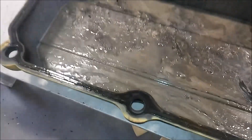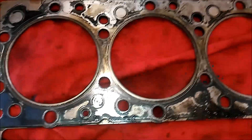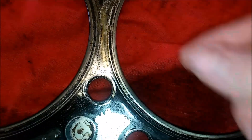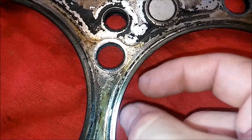The next thing we're going to do after pulling the head is inspect the head gasket. There are actually different parts to a head gasket. This little steel ring that seals the combustion chamber is called the fire ring, and this is the most critical portion of the head gasket. When you inspect the head gasket you're looking at the fire ring — looking for damage to it, cracks, burned out marks. If any of those are there, you know the head gasket failed.